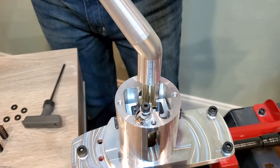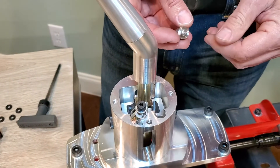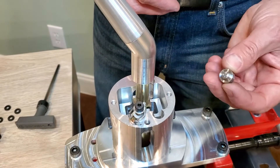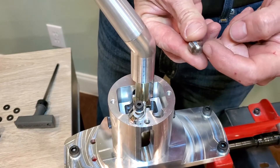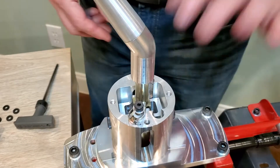These will be covered in grease in the shifter that you get. I've left the grease out on this demonstration so you can see what the parts look like. These buttons stay down inside. If you happen to accidentally pull one out with a magnet, it goes back with the protruding button piece facing downward, but you can just leave those down inside.